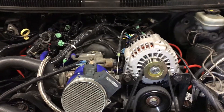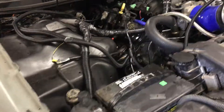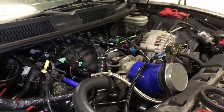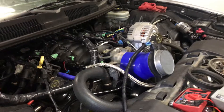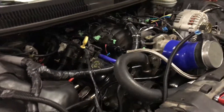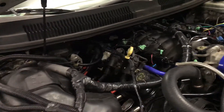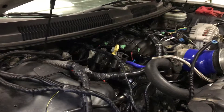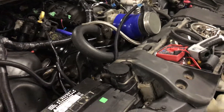The only thing I have to do yet is check the O2 sensors. I believe they're hooked up right. It actually has case-grounded O2 sensors connected to an isolated harness. According to the guy who created the LT1 swap website, that should work fine because not only are the O2 sensors getting a ground from the block going to the heads, headers, and then the sensors, they're also getting a PCM ground from the wires — so you're basically getting a double ground. I need to double-check that it's getting the right readings, but I don't have HP Tuners.